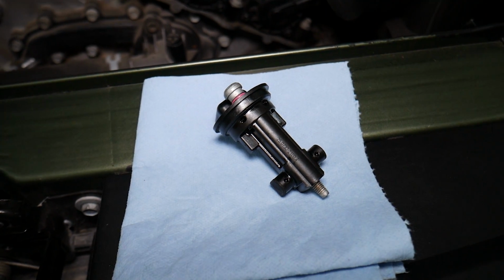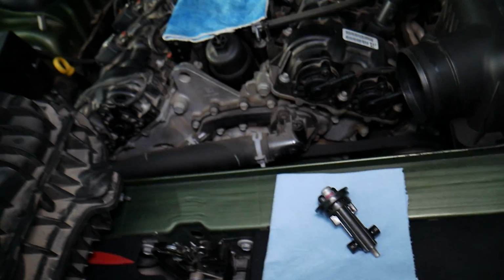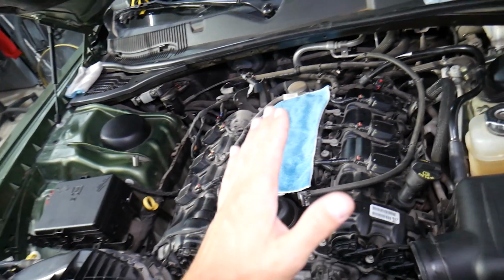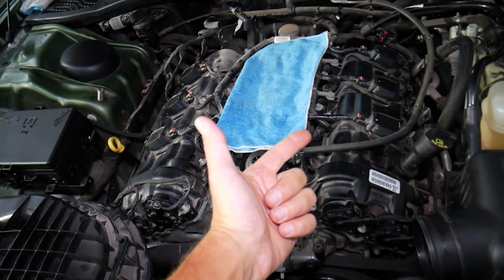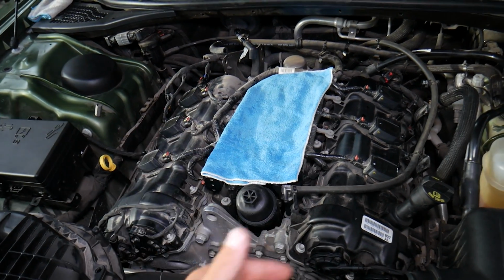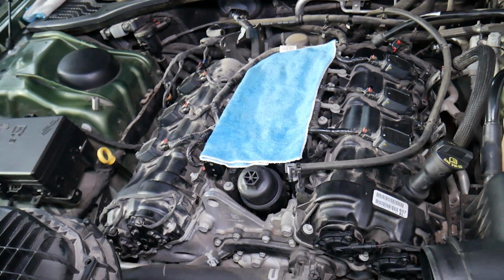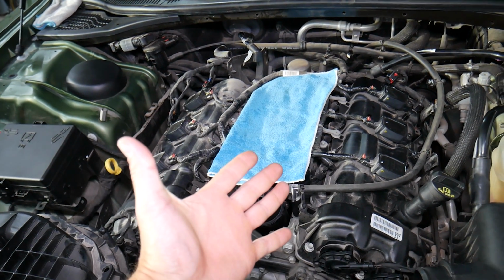On most German and Asian vehicles you have dual sensors, but if that sensor is bad, let's explain what it can cause and how it can affect your car, and from there we will explain can you drive with one or not. So first, if it fails, you may experience taking a long time to start the car. Number 2, rough idle, that means that the RPMs will go up and down, the car will try to die sometimes, or the car will be revving up. Number 3, the variable timing may be turned off. Number 4, it will not meet emission standards. Number 5, increased fuel consumption.